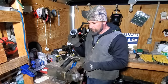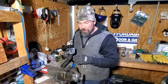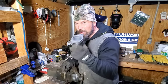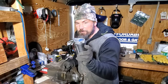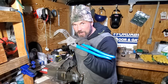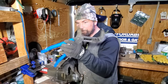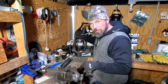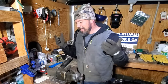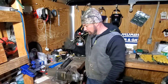A while back somebody asked me about changing springs. I made a video but the audio didn't work out, so here I am again. Luckily I got to make some springs today. We're going to go through how to take these cones off springs — it seems like magic or it's overwhelming, but it can be done. The secret sauce is these guys right here: big channel locks, what we call 'big blues' around our shop. That and some kind of torch is pretty much all you need. The vise is very helpful too.